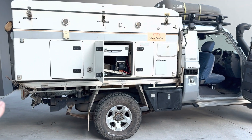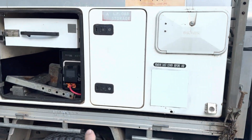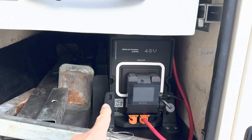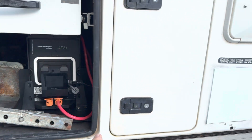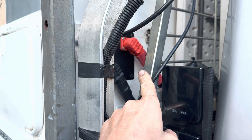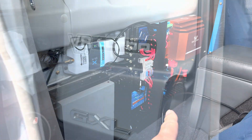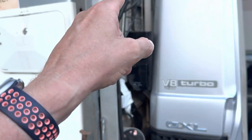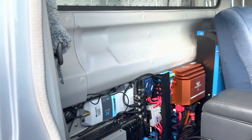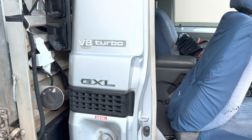With the travel lander on the back, the batteries that were in the back of the tray are now moved inside the camper. You can see we've got other things in here, but the 48 volt batteries are in there and we're using the Amphenol connectors up here to connect through to the inverter charger. There's the Scotty again. The 48 volt battery now goes through the Amphenol connectors into the car. And then when he camps, he takes the back off and the batteries slide into the tray. Peter actually gets the best of both worlds.